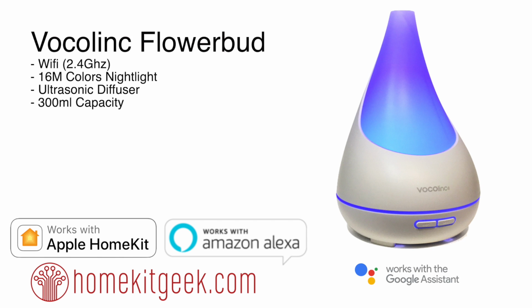So this is not using steam. This is using ultrasonic diffusing capabilities to kind of turn your essential oils, your water, into a mist. So one thing you do want to be aware of here is you probably want to be using distilled water if possible. Otherwise, you might actually just be taking the chemicals and impurities in your water and just putting them into the air so you can breathe them, which we don't want to do. So that is something you're going to want to watch.